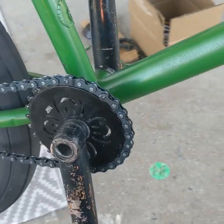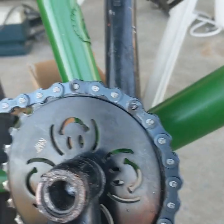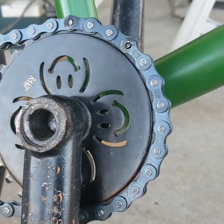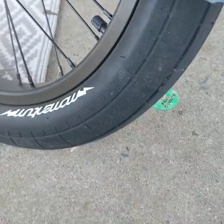It clicks as I go by right there — that's not even in, that's not safe. We're probably just going to pop that link out and the one next to it and put a master link on there. See, that's not even in there — neither is that one. There are a couple broken links on the chain, so I'm going to fix that. This one's maybe saveable, I hope the one over here is saveable. I guess if I realigned it and pounded it with a hammer that could work. Thanks for watching — bike check coming soon.